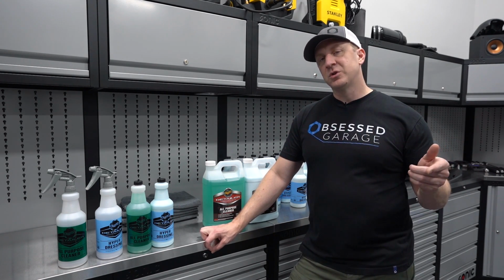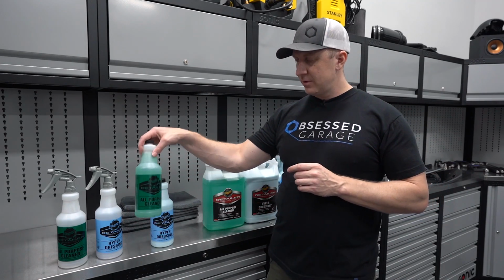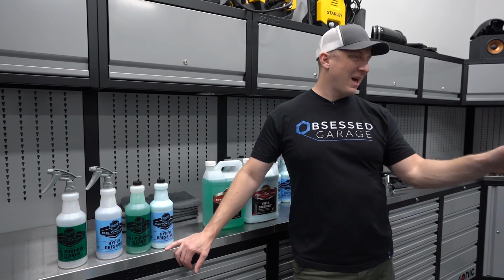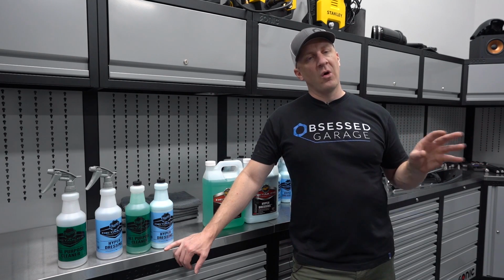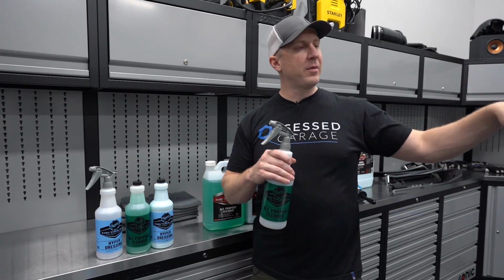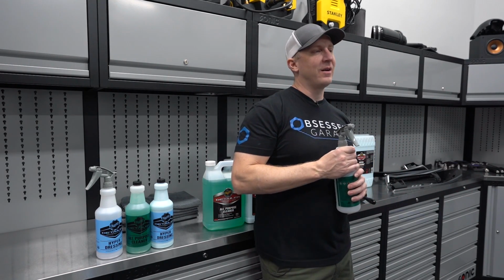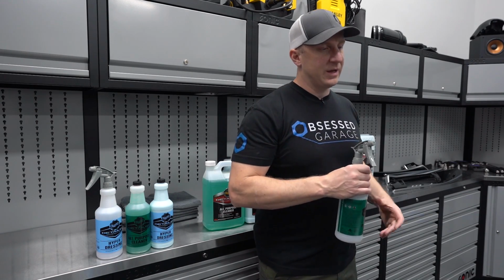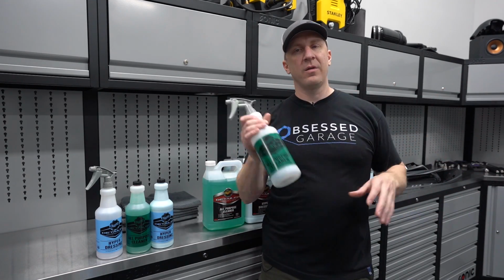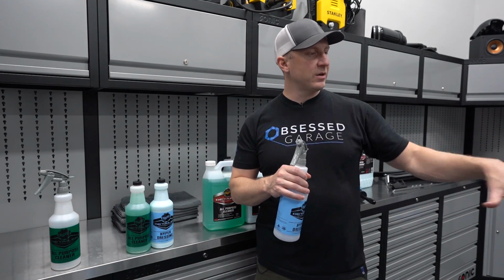So the way this works, and one good episode to go and watch, I'll put it up in the cards here: go watch episode 2 of the F10 M5 detailing series, where I dilute all-purpose cleaner 4-to-1 and I dilute hyper dressing 4-to-1. I rinse it down with my pressure washer, cleaning out as much as I can, and then I follow with spraying the whole area down with 4-to-1 all-purpose cleaner, including the heat carpet, whatever you call that thing, on the underside of the hood. I'll then use Easy Detail brushes or the Race Glaze brush just to agitate areas that need to be agitated. I spray off all of the all-purpose cleaner, and then I follow with 4-to-1 diluted hyper dressing, and just spray, saturate the whole area.